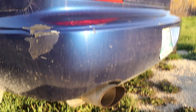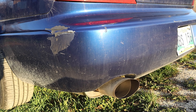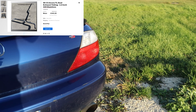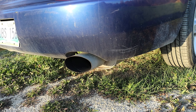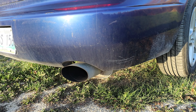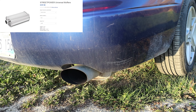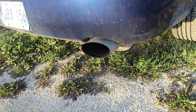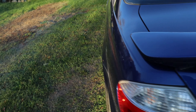I have a full three-inch exhaust system from Truebends, which I'll link in the description. You have to buy it for the Acura TL — the 2G TL — but it fits the CL just fine. Then basically get whatever mufflers and tips you want. I have some Vibrant three-inch straight-through mufflers and the tips are made by X-Force, but you can really go with whatever you want.